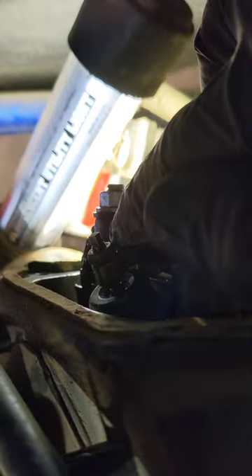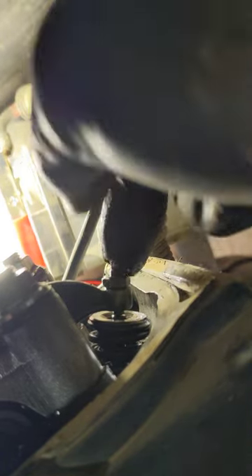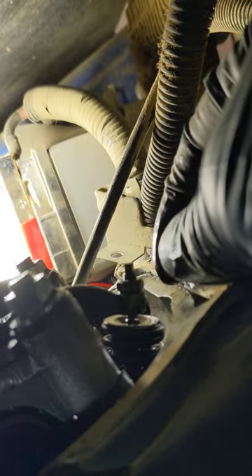There's a 10mm nut on your rocker arm. Take a 10mm and loosen that nut. There's your exhaust over here. Same thing — loosen that. The clearance spec is four thousandths or 0.10mm on the intake, and five thousandths or 0.12mm on the exhaust. Slip the feeler gauge in between the arm — see that little bit of clearance there. You can't guess that; you have to use feeler gauges. Slip it in between this post and the top of your valve where that clearance is.